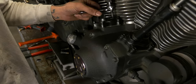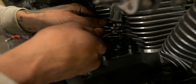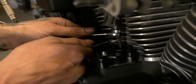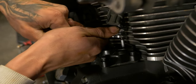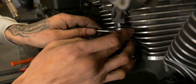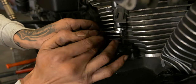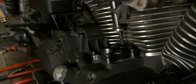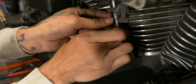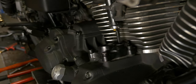Since this bike's a little tired and has some miles, and this is the only upgrade that seems to have been done to the motor so far, we're gonna go ahead and pull these out because we have some new tappets and everything. And we'll give them some fresh O-rings, and we'll go ahead and throw in new push rods. That way everything starts fresh at 0 miles. You'll see there's a little bit of load on them, so they won't go in just yet.